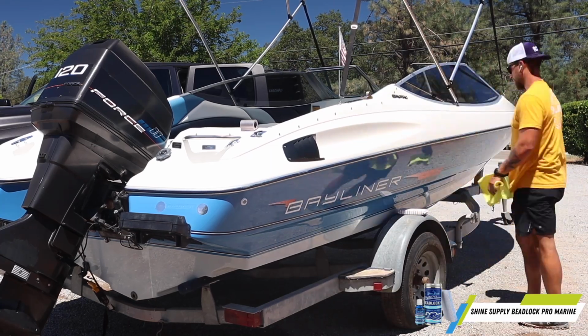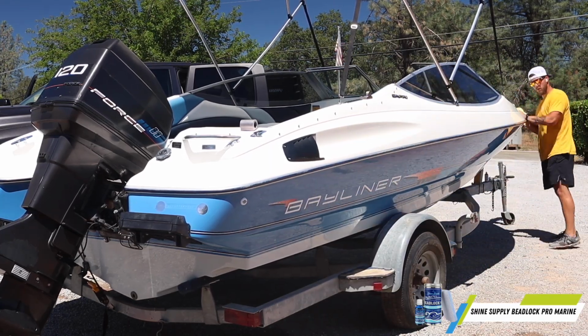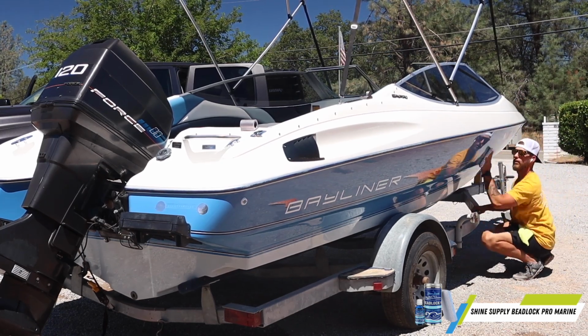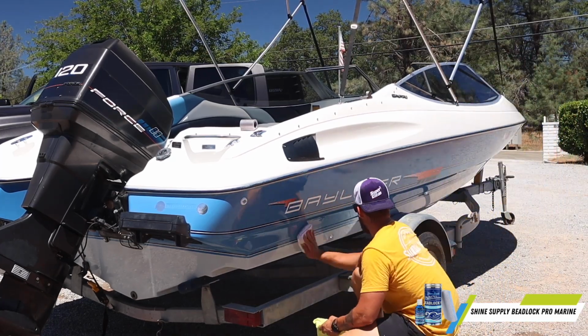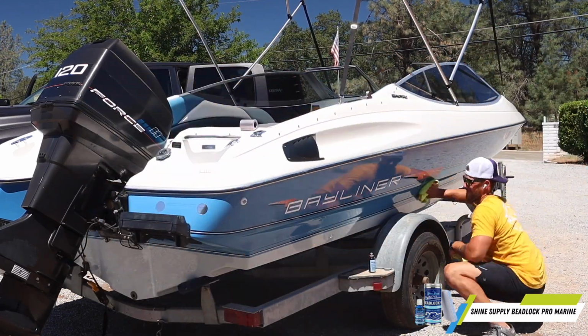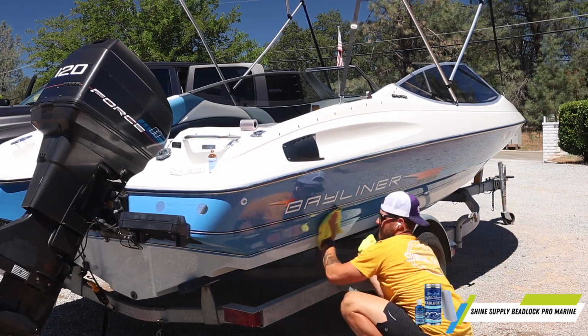Now it was, I believe, like 104, 106, like I said, it was flashing off and it was leveling very quickly, almost like 30 seconds to 1 minute. So I know that I've made videos in the past going 5 minutes. You definitely don't want to do 5 minutes when it's really hot like this. And that's why you always want to check. Once you understand ceramics and stuff, you'll understand like, hey, it's super hot, I know that I could flash. But until then, do a small test spot, wait until it's tacky and then level it off. That's the best thing you can do.